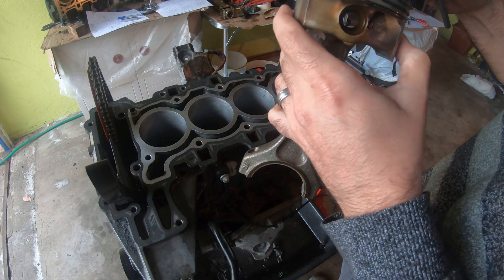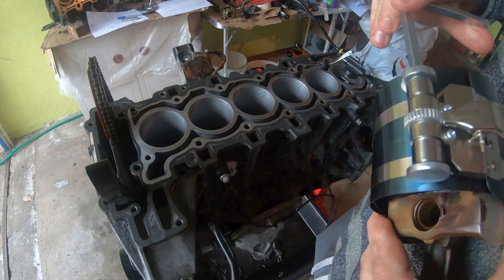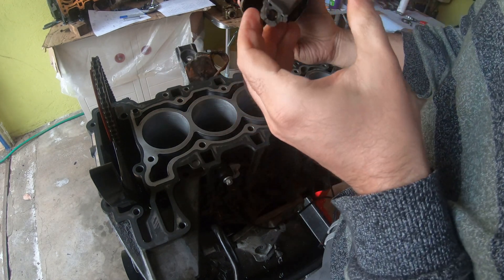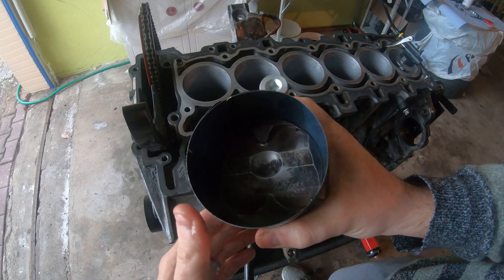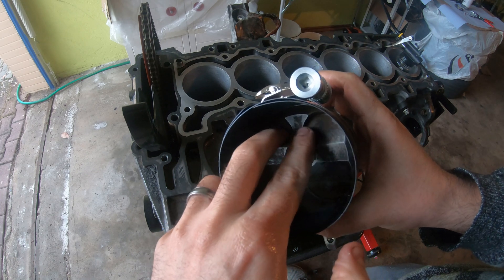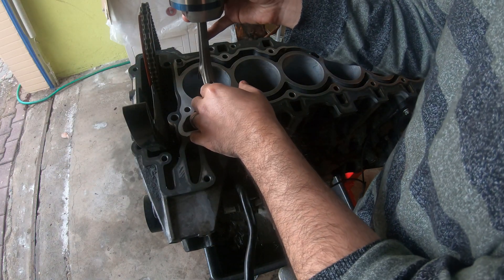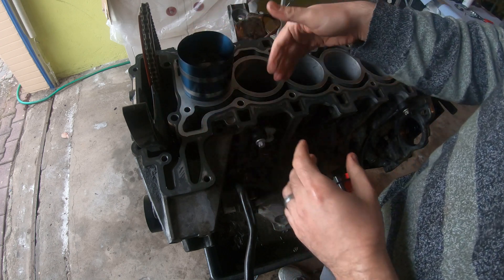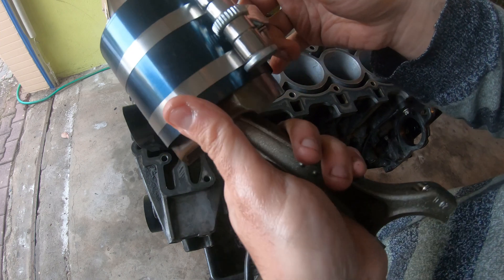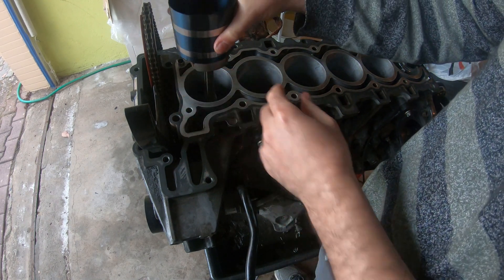So now I'm going to gently set it in here. You have to get the direction of the piston right. The two intake valves — if this is the front of the engine — two intake valves are on the bottom, two exhaust valves are on the top, and there's the part number there. So the timing chain is right here. The crank has been turned so that it's facing downward — it's at the bottom of the stroke. When you put the piston compressor in, you don't actually need to put it all the way down. You can use the piston skirts kind of as a guide to help you center your piston.